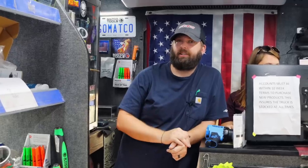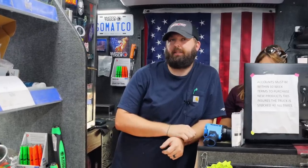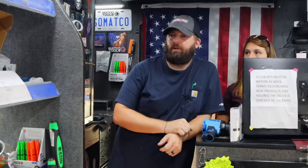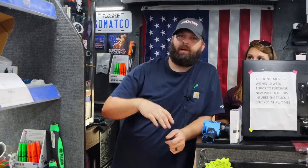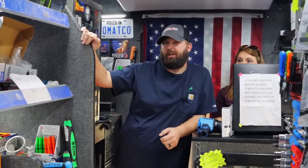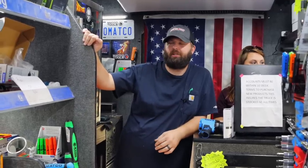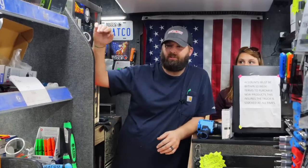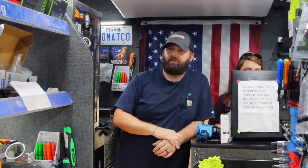I'm interested to see. Somebody may have been pulling my leg on that, but if not, that's a good idea. I've heard rumors of that for a long time. If that's true and they've come out with that, that's a good design. I like that idea, because most times your newer techs especially are going to run that thing down with an electric impact, and then take their torque wrench and put it on, beep, and it's not going to turn. Okay, it's good. I won't say that we're not all guilty on that, on tires and stuff like that, even though you're not supposed to over torque lug nuts due to braking issues, stretching of the studs and all that good stuff. But I think we're all guilty on that. It's till it hammers a couple times and it's tight.